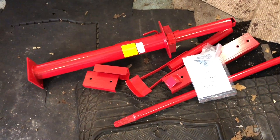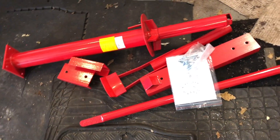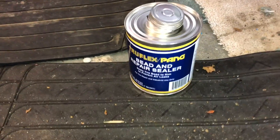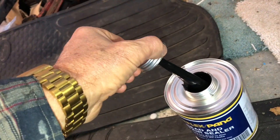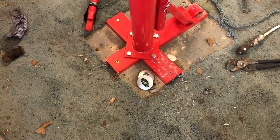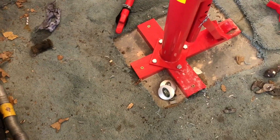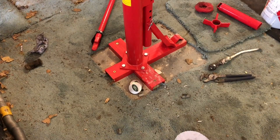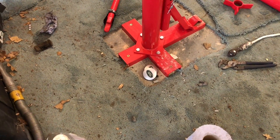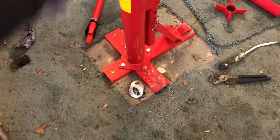This is the kit of parts you get with your tire changer — 46 pounds on eBay, see links in the video description. I also picked up on eBay this bead sealer and repair, which is quite handy because it's black, matches the tire, and comes with a brush on the end. Once you've assembled your tool, try to mount it onto the floor — I used my masonry drill, drilled into the concrete floor, put in some plugs, and used long wood screws. It seems to hold it firmly enough.